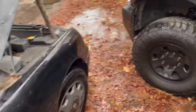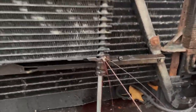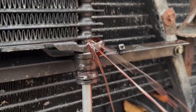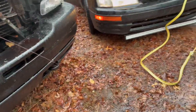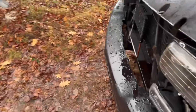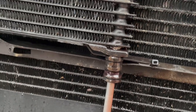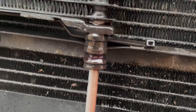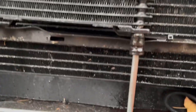Here's an up-close view of it since we got the grill off. Oh, I forgot the jumper cables aren't on it anymore. So we can see a clear p-stream. Yeah, that's toast. Look how far that thing pees - that's like competition distance. I don't think there's any real way to bypass that because that's basically at the cooler itself. I don't think I could JB weld that or anything - I wouldn't trust it. So I think I'm gonna have to get another cooler.